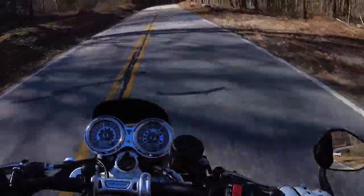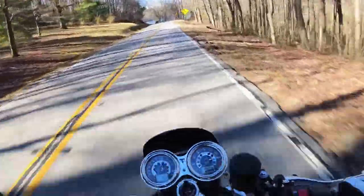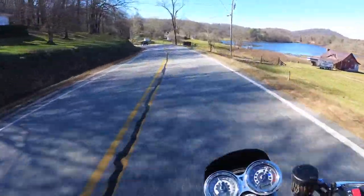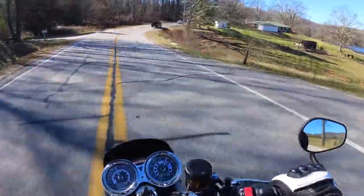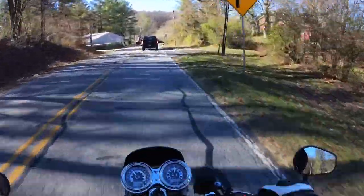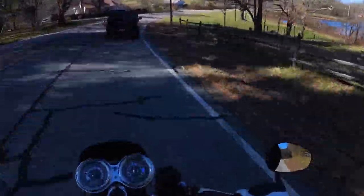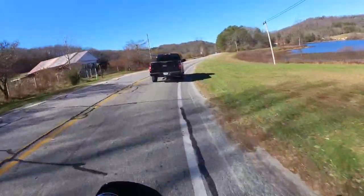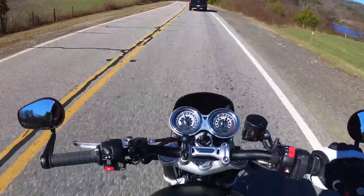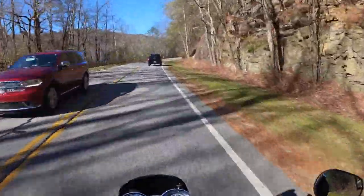I've got the zip tie on the front fork — I want to see how much suspension travel I'm using. A lot of people just set it for an amount of sag and use that as a starting point, but then I go out and ride it hard and do a stop — things like that — kind of put it at the absolute max you think you're ever likely to bottom out. Then go see if you have like an inch of suspension travel left, where you're down to almost bottoming out. When that happens, that's when you can lose the front. Looks like I still have about half an inch — I think we're okay where we're at.